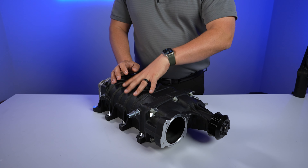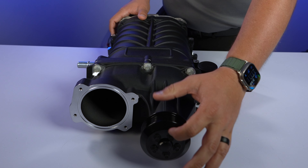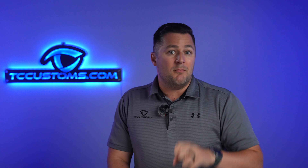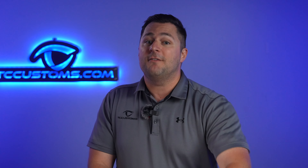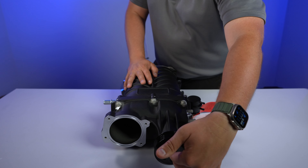If you wanted to get more horsepower out of this supercharger, you could get more rotations by adding a smaller pulley. However, you'll notice there are a couple of bolts on the front side of the supercharger and those bolts have little markers on them — so Roush Performance can tell if this pulley has ever been removed, meaning you're trying to make more horsepower. If you do one of our specials — the 705 horsepower F-150 for $44,990 — make sure you do not mess with the pulley. If you do, it voids your warranty. Even if you put it back, they can tell. Don't try it. Adding a smaller pulley is a great idea once the vehicle is out of the full factory warranty.